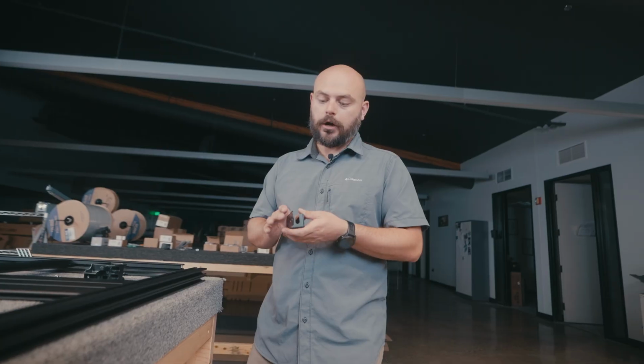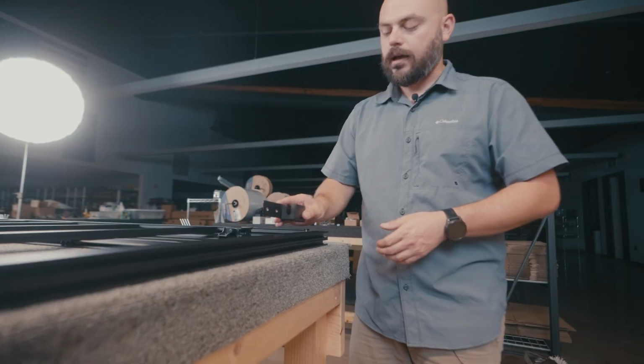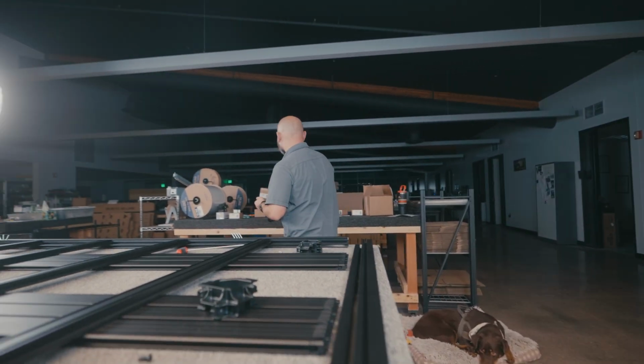Onto the final perimeter piece of the extrusions here. One thing to note here, this is technically the rear of the vehicle, the rear of the roof rack. So at this point, one of the accessories that you need to know about if you're planning on installing a chase light bar is the chase light bar mount. You have to install this before you get the final 2 corner caps on at this point, simply because you won't have access to that M6 slot otherwise. So especially if you're mounting it to the underneath side of things. If you're mounting it to the side, doesn't matter, you can do that whenever you want. But if you wanted it low profile tucked underneath the roof rack, that's when you're gonna wanna insert your hardware for this at this step. We're not doing that on this rack, so more for demonstration purposes.